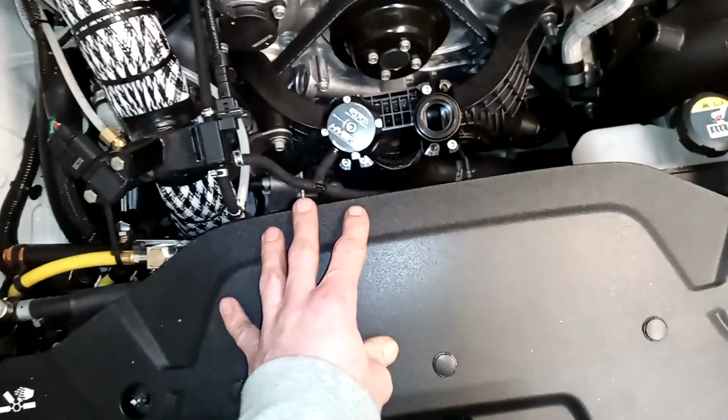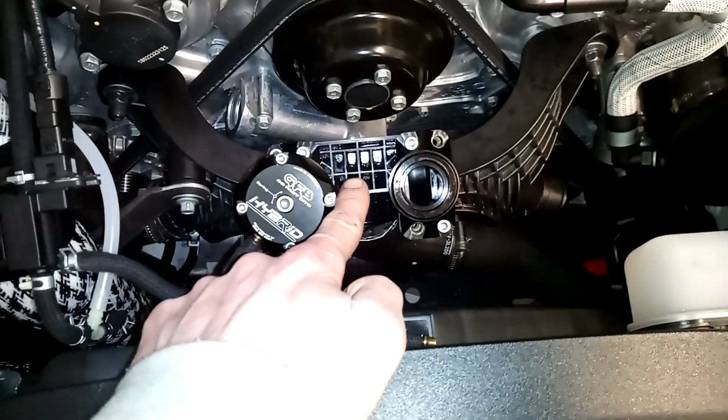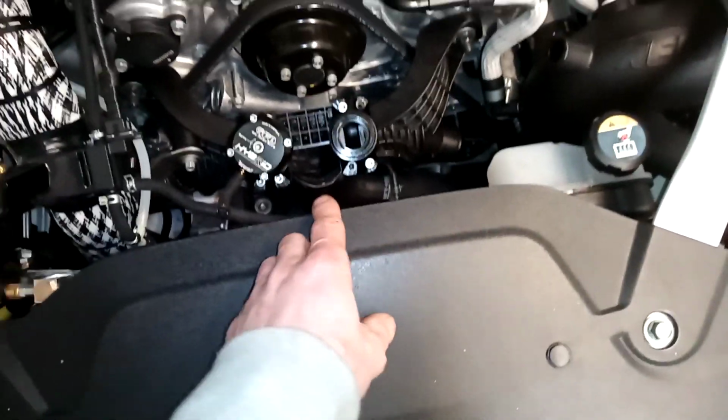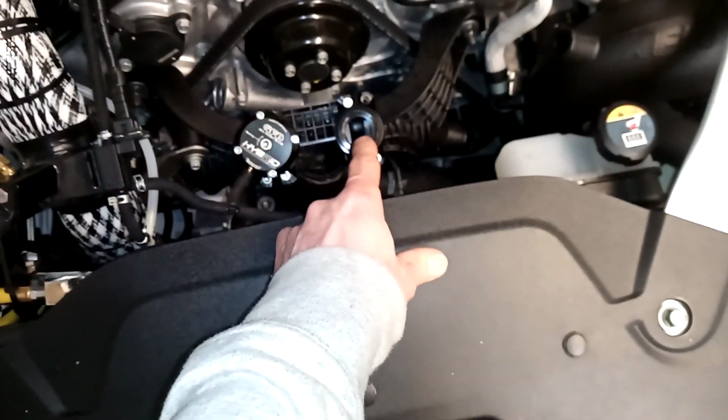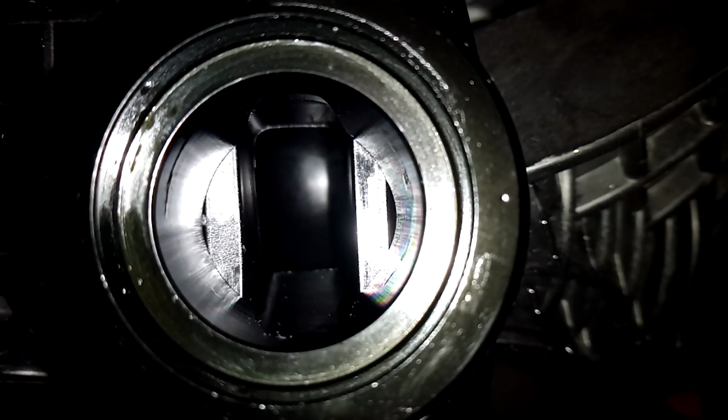So in doing the leak test, I hear air coming out of it. So I started to look at it, and if you have the plastic little plenum collector, whatever you want to call it, if you have the plastic one, you cannot use the GFBs. If you look inside, you see the gap on the far left and far right.